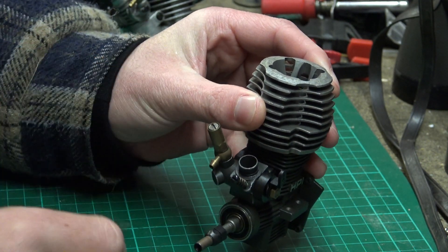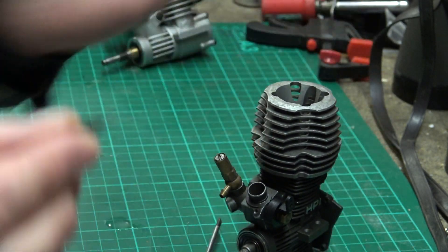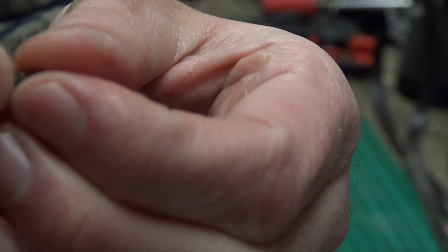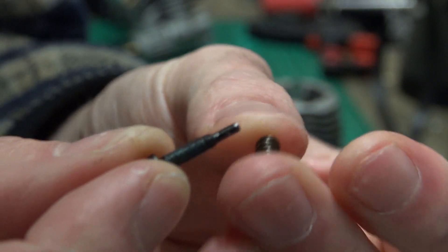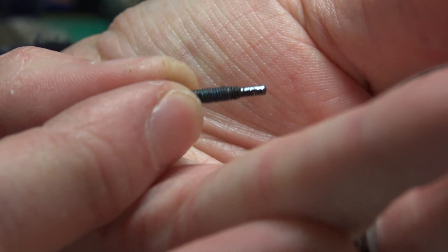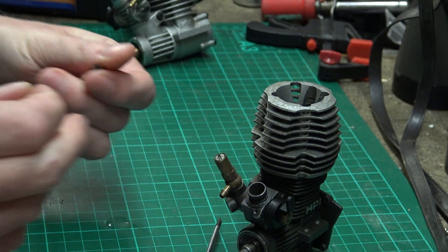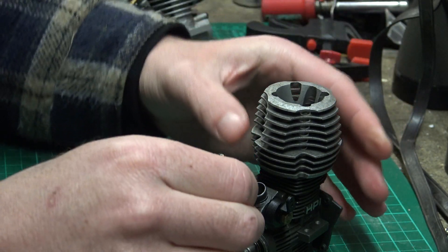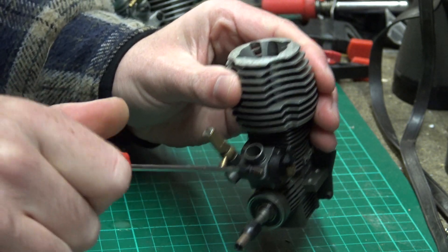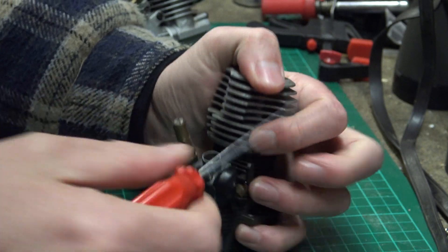Alright, there we go. So what it is — this one isn't necessarily pointed — it's just a screw. It's a threaded screw with a little spring over it, and the end of it has got no thread on it, it's just thin. So what that does inside the carb is it will just push on the throttle. I'll give you a demonstration where it doesn't actually affect the tune in any way whatsoever.